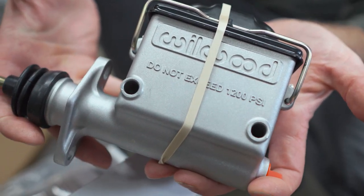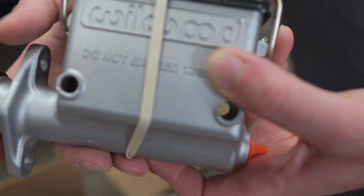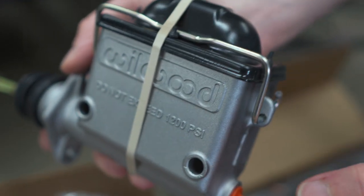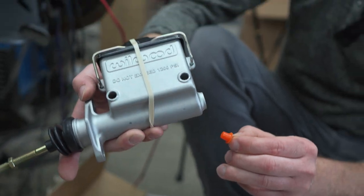It's a little miniature master cylinder. For the OEM look, we've elected to use the integral reservoir master cylinder. This has one output per master cylinder - this is an eighth inch out. We'll go ahead and plumb this up to three-sixteenths AN fittings, dash three AN, to do all our brake lines with tube nuts. Seven-eighths for the rear, which is using Wilwood four-piston Dynalite calipers.